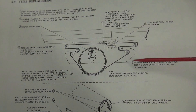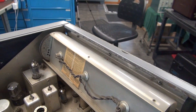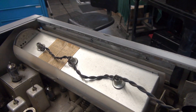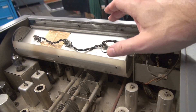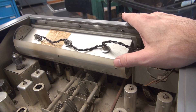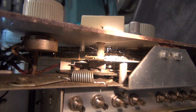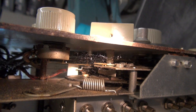There's the layout, but the only way to access this and do it right — if you're going to do this, make sure that you turn the dial drum all the way forward like this before you pull the chassis out, where you can crack that plastic, and that would ruin your day. Taking a look up there, I can see the edge of the pulley.